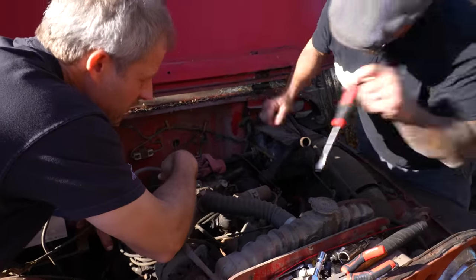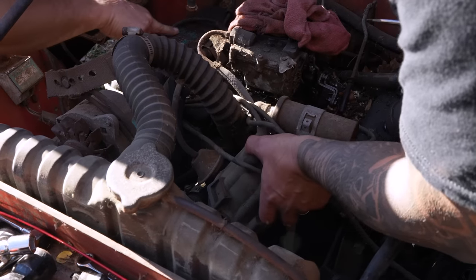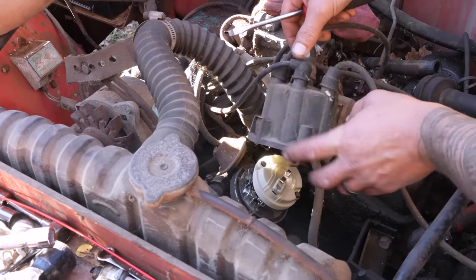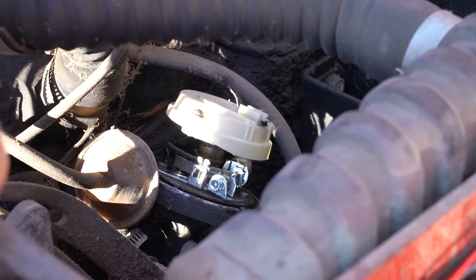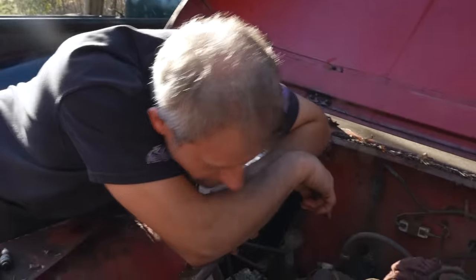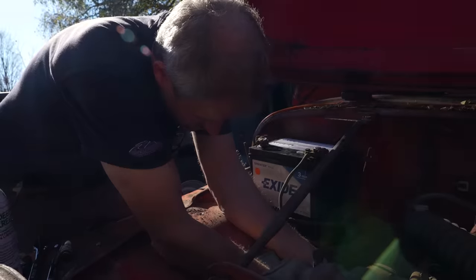We know the points are going to be rotted — that's kind of a given in my opinion. I got the firing order right over here in case you need it. Coil wires off. Oh my gosh, that actually looks kind of clean — they all look really clean. The points look clean. Now, you have to pull the rotor to get to them, and then pull half the weights off. You might have to pull the condenser out of the way to get to them. Let's just check and see if we got spark first. Let me grab a fresh plug. I got no spark right now.